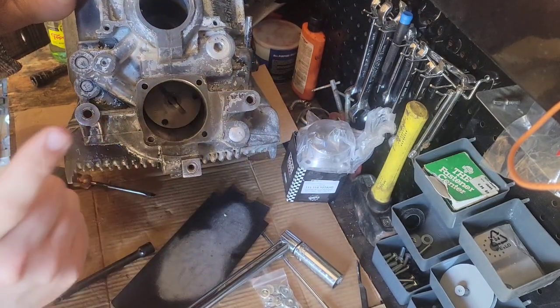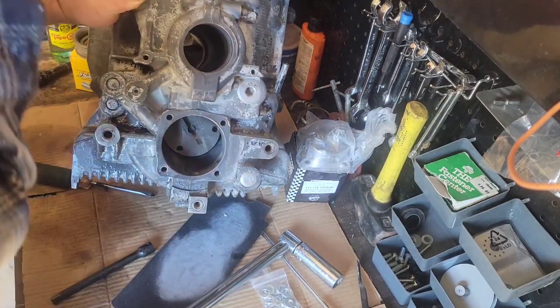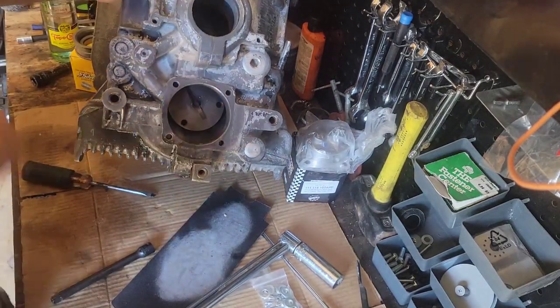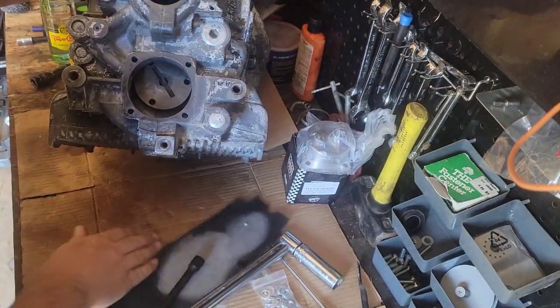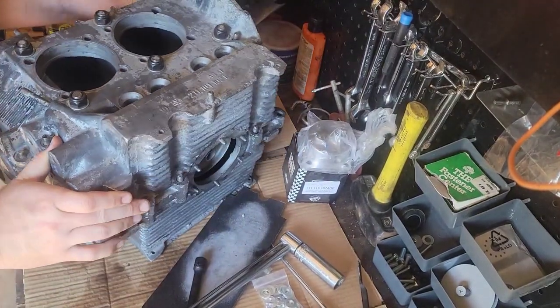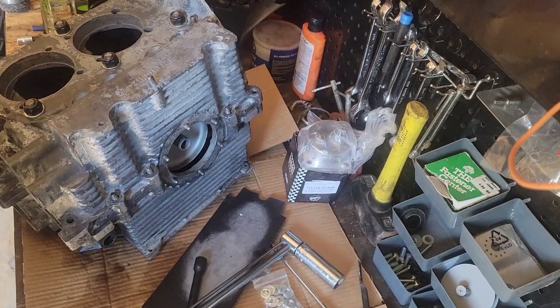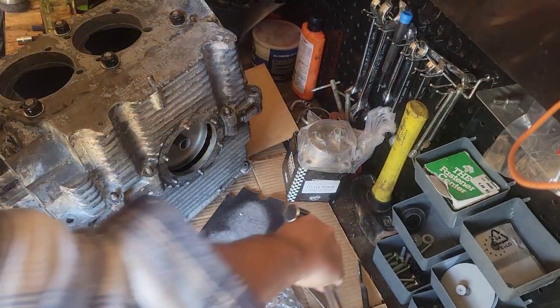It's torqued down. Our bearings are in there, camshaft in there, everything's lubed up. Make sure everything's clean. You don't want to scratch any of your bearings or your surfaces on your camshaft or your crankshaft or anything else. Now we verify that that spins freely. We can take it back apart. Find me a regular ratchet.